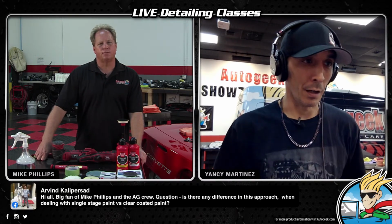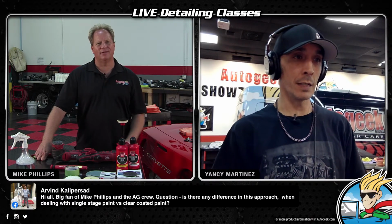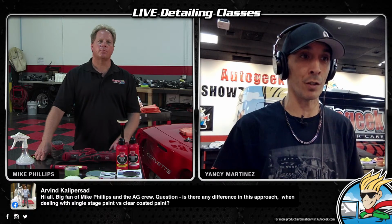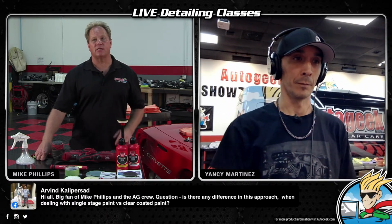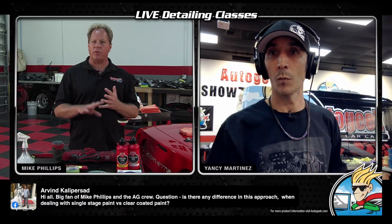All right, let's go back here to Arvind. Hi all, big fan of Mike Phillips and the AG crew. Thank you. Question: is there any difference in this approach when dealing with single stage paint versus clear coated paint? Good question. There's no difference in the process, but there's not a lot of new cars being made with single stage paint. Toyota being one of them. Most of their white vehicles use a urethane single stage paint, which is very hard, so be very careful.